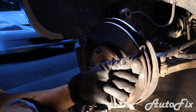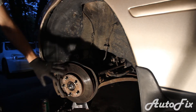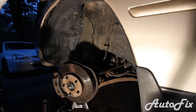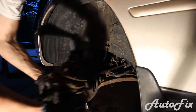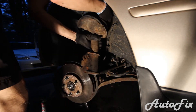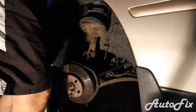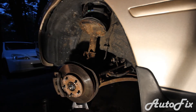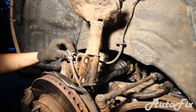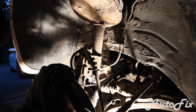Don't forget those brackets - I had to take it back apart and put them in. Actually I was able to use my long extension to get in there, get two screws at a time out, put the bracket in, tighten them back up and torque them down again. Now let's get the strut back in, put the bolts back in, and reconnect the brake hose and ABS line. If you removed the top of the strut, torque those bolts somewhere around 30-40 foot-pounds. Sorry for the bad lighting - it got dark outside and I only have one light.